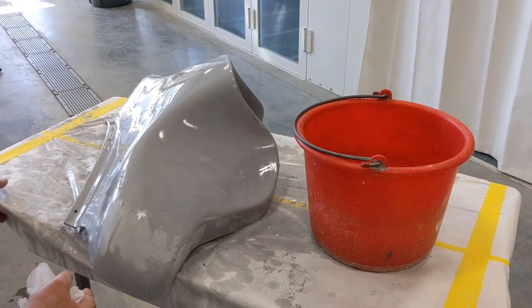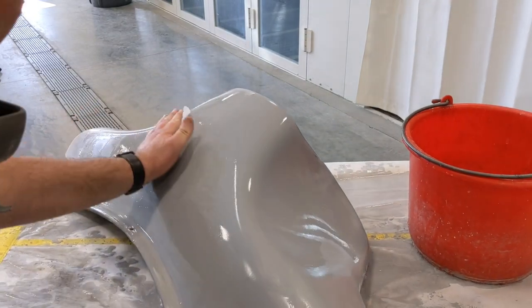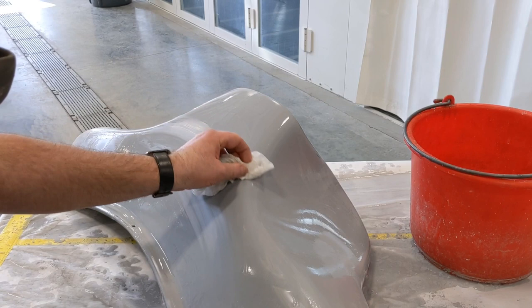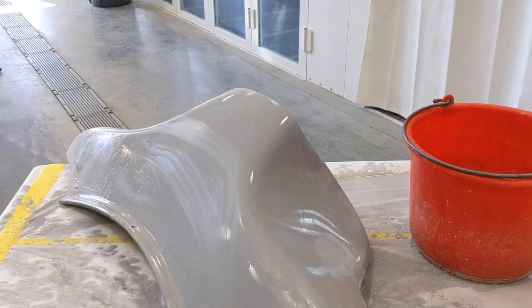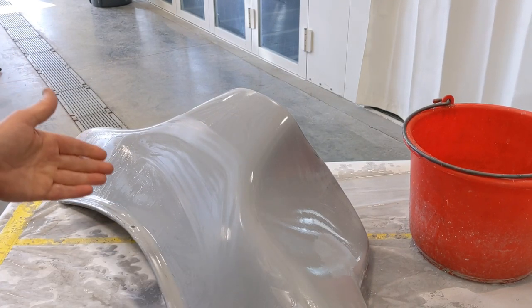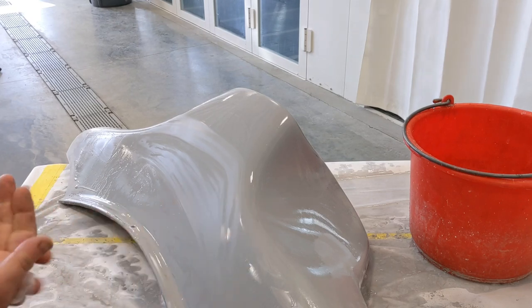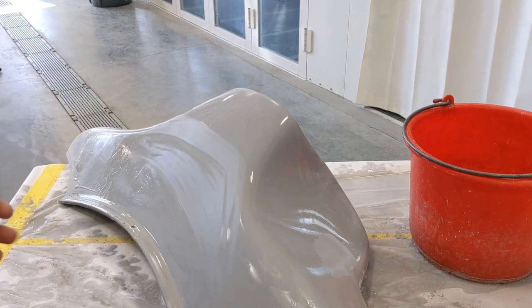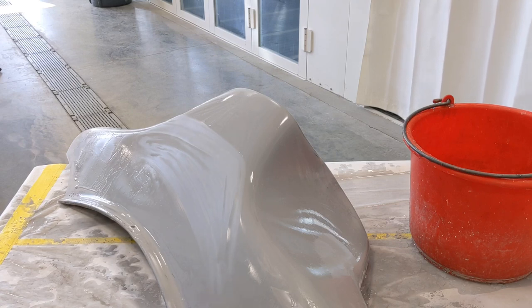Get a feel for what this is kind of producing here. Giving it a really, really soft, velvety, smooth finish. And that's exactly what we're gonna want. So that's the 400 right there. I'm gonna bump it up to 800 after, just go over it and get rid of all those 400 grit scratches. And then this thing will be ready to go. I'm gonna go ahead and do both pieces, get them all finished, and show you what they look like when I'm done.